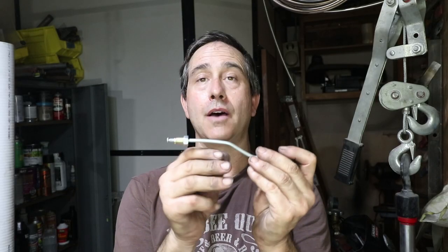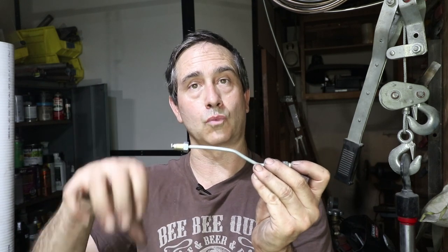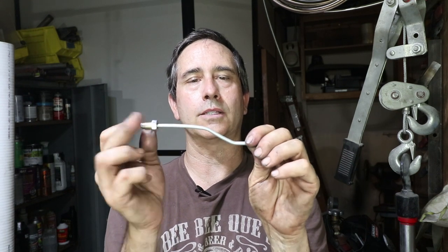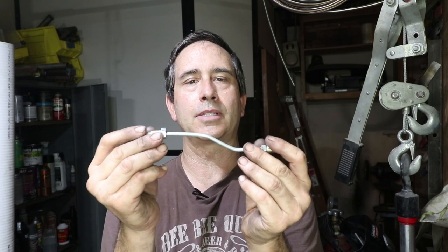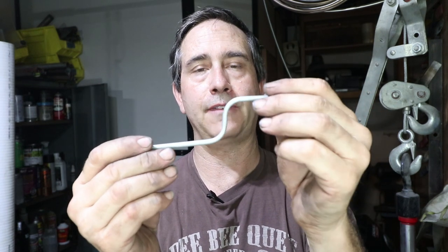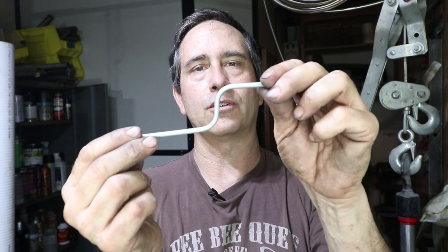Slight change of plans on the shape of the bends. What happened is I was able to get it in the flex line which is rigidly mounted to the trailing arm, and then to the caliper which is also rigidly mounted to the trailing arm. It ended up being too short — there's just not enough material to stretch it because you have to shrink it to fit inside both cups and then when you tighten it down you have to stretch it. So this is just a test bend, but when I tighten both ends down it'll stretch it into about a not-quite 45 degree angle, allowing it to stretch.